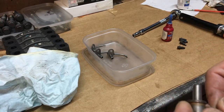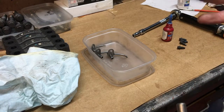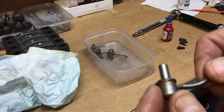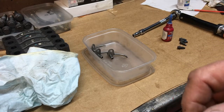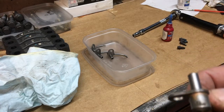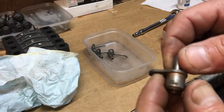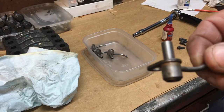The earlier type is literally just a tube with no valve. This later type has a non-return valve — basically a ball and spring. So if you get low oil pressure at hot idle, this will shut and save oil pressure to the rest of the engine rather than losing it through an open hole. This engine is from April 2011, so if you're before April 2011 you may have the earlier jets, and upgrading could fix oil pressure problems.